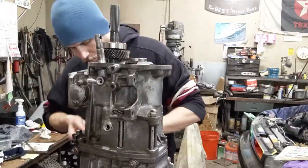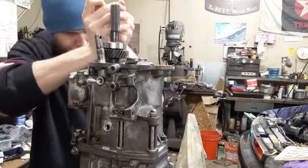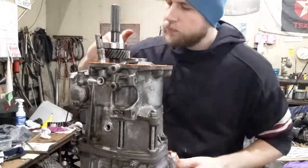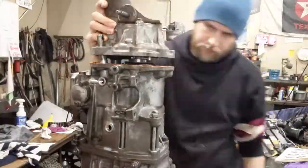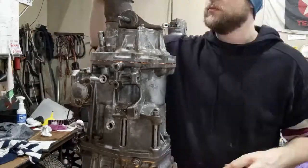We then made a gasket for the center differential with the red goo. We had to make sure the output shaft and center differential were seated correctly. This would allow the case to seat down the way that it should.